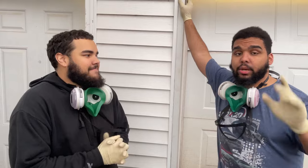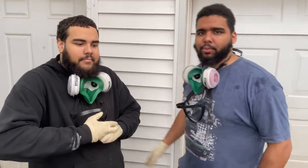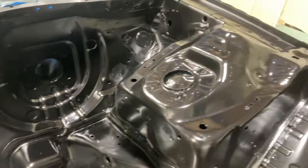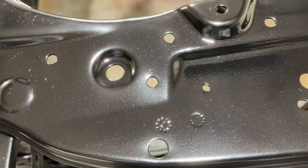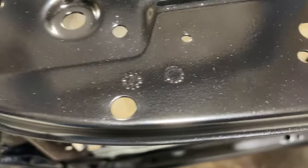Let's take a look at the base coat. It's actually coming out good — we have no defects right now. There are some areas we're realizing we have to pay a little more attention to. But let's go inside and take a look before we hit it with the second coat. It's flashing actually pretty flat, which is what you want to see. We still have this area — the last area we hit on the driver's side strut tower — it's still wet. Those sparkly things are actually metallics in the paint, not trash. All that sparkly stuff is metallics.